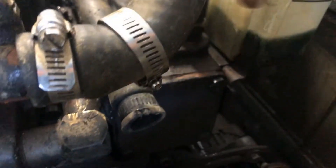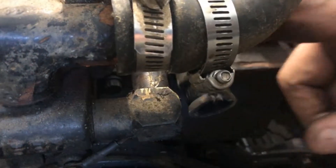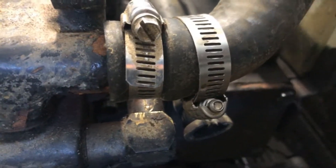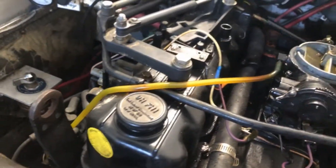I disconnected the exhaust manifold out of the system and the water intake, plugged one end, then adapted the other with my MightyVac and pressurized it to 20 pounds — it held for a while. Then I put a bilge plug in the other end with a hose clamp to seal it up. I noticed a bunch of rust down the side of the manifold, and then I saw RTV silicone, which shouldn't be on there, so I decided to pull the elbow.